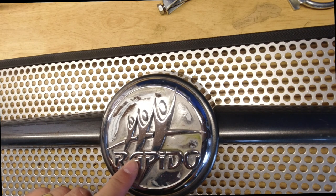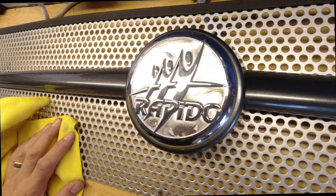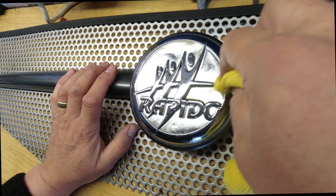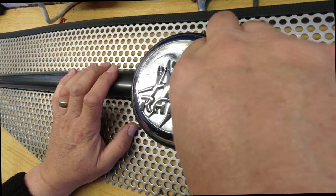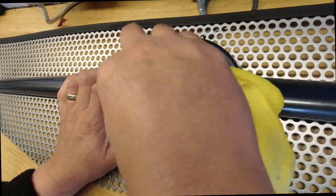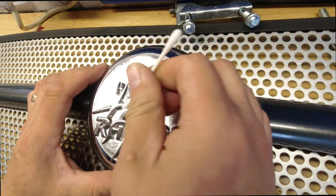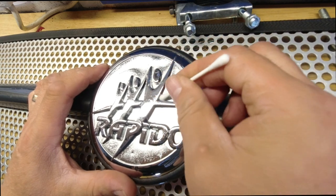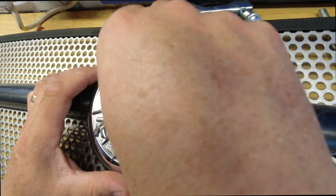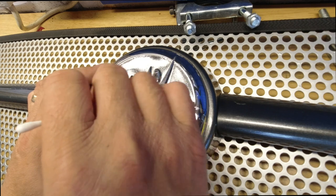Having a little bit of deposit down in the cavity, you should be able to scratch it out with a knife. That's all done, so let's just give that a quick cleanup. I'm going to use a bit of alcohol to clean up any wax or anything else in the bottoms of these pits, because they're quite green in places and that might stop the paint from properly adhering. For the fine detail we've got a cotton bud, just get into all the corners and clean up as much as we can to get a good key. I'm using alcohol because if I don't get it all off it won't matter - it'll evaporate very easily and quickly.